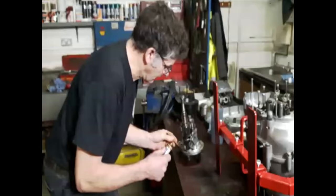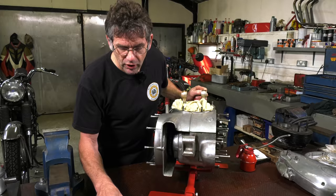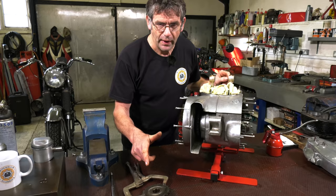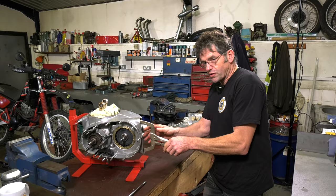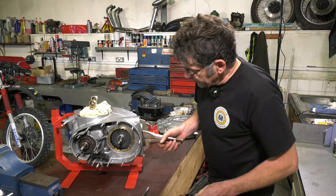Just going to bring you back up to speed on where we are with this engine from last time. We've put the gearbox cassette back in — it's quite easy to put in. The detent is at the back, it all lines up properly. When we come to put on the drive sprocket, I've left the old one on with a pair of grips here. It's a little trick: when you've got the bike in the frame and the chain on the sprocket, it's quite easy to hold the back wheel and stop that sprocket turning. But when the engine's on the bench, you want to hold that sprocket and do the nut up tight. These are just mole grips and they work quite well to actually clamp it. Get that nice and tight.